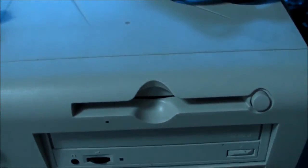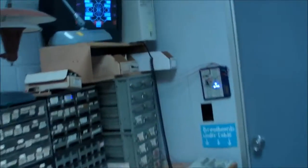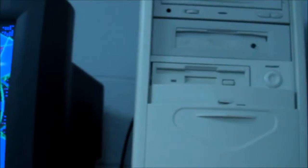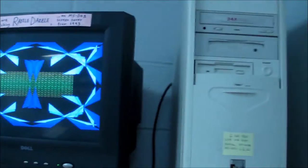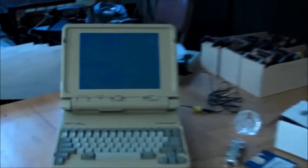To get the Pac-Man program on this machine, I had to go a roundabout way with a bunch of different computers. First, on my main office computer, store it on USB. Take that USB to this Dell Optiplex GX110 to copy it onto a 1.44 megabyte floppy disk — because that machine doesn't like to read or write 360 kilobyte. Then take that 1.44 megabyte floppy to this older Nexcom computer, copy it to the hard drive, and then put a 360 kilobyte floppy in and save it on there. Finally, take that 360 kilobyte floppy with Pac-Man and stick it in the Zenith.